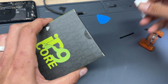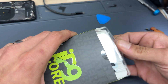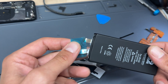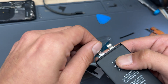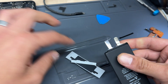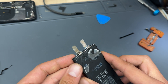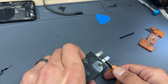Now that that's prepared, we're going to get our new battery — this is the IP9 Core battery from iPod for you. These come without a BMS already attached. You've got the adhesive, the cell itself, and raw battery terminals, which means we can cut them down and weld them straight onto the BMS. To make sure it's exactly the right length, hold up the old battery to the new, then take your cutters and chop it off in the same place.